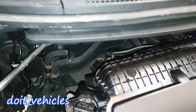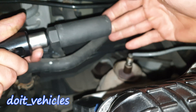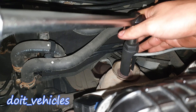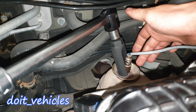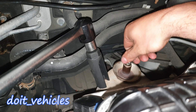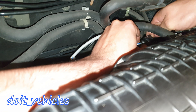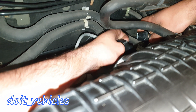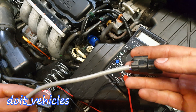The air-fuel ratio sensor on this car is located back there on the exhaust manifold. Go ahead and use the oxygen sensor socket with some extension and a long breaker bar. Place the socket on the sensor. If it doesn't come out easily, spray some penetrating fluid down here and it should be removable after an hour or so. When the sensor can be undone by hand, you'll also find the connector — there's a little tab in here. Press it and remove it from the bracket, then press on the other tab and the connector will come out. Then you'll be able to undo the sensor all the way out.